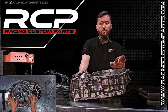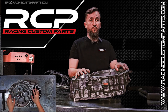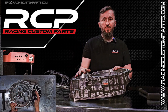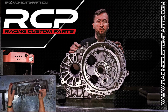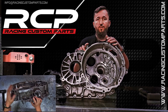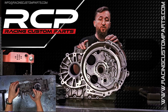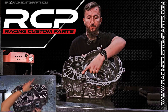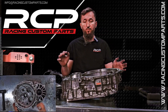That's how it's done, and that's how you need to do it. If you just make holes for the adapter and raise the transmission by 10 mm, the starter ring won't work. So after machining, the transmission will look like this — the entire surface lowered by 10 mm, exactly the thickness of the adapter. It was milled here for the timing chain for R32 engines, and the three reference points: first, second, and third. These are very important reference points — don't forget about them.